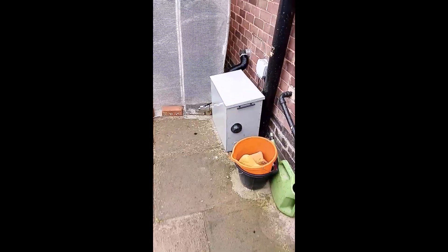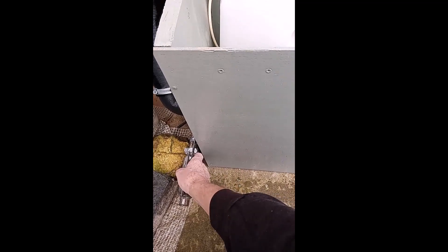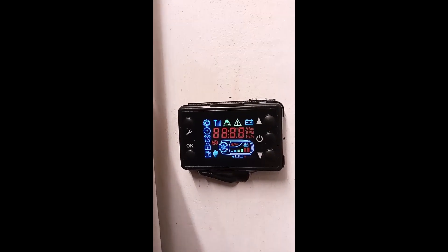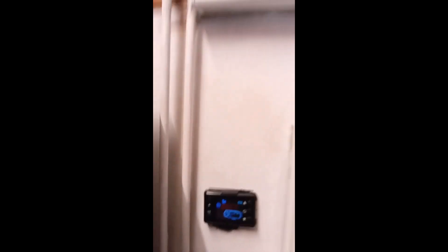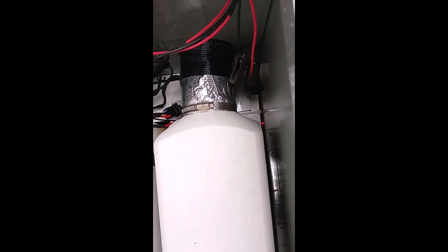Quick update on the heater — it's got a fault on it. I put it in and it's cold, it's not on. As you can see the power light's not on down the bottom and the fan's not running. If we go inside you can see the power's not on. If I switch the power on you can probably see the fan icon's on but it doesn't show it running — now it's running constantly all the time, even when this is powered down. Going back outside you'll see the red power light's on on the transformer and you can hear the fan running.